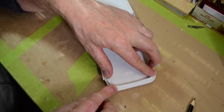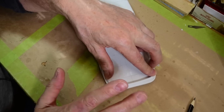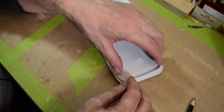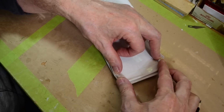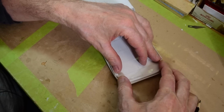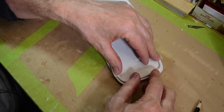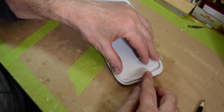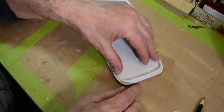And then I'm just going to have to build the fairing. I want to try to stay away from any epoxy putty or filler if I can. As you may know, I only use it if I absolutely have to. I try to do everything with plastic and weld because you can do cool stuff with plastic and weld. You can fill big gaps and shape parts that you never thought you could. But that's what I'm going to do, start with that, and then I'm going to have to build the rear of the transom sort of over top of that, I guess.